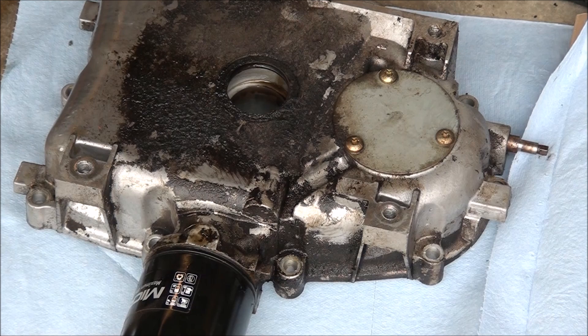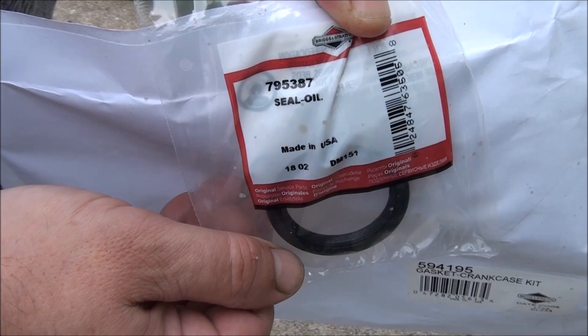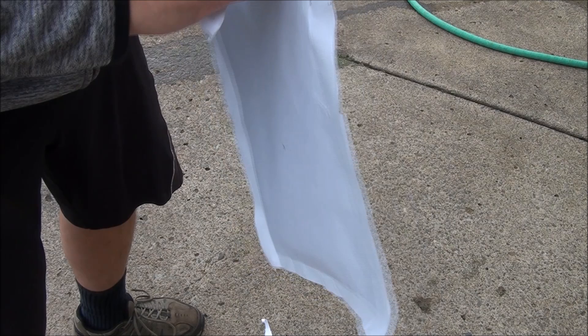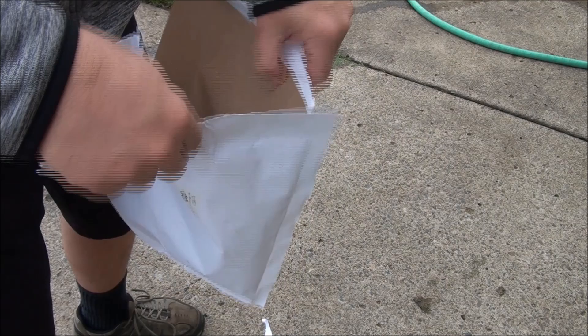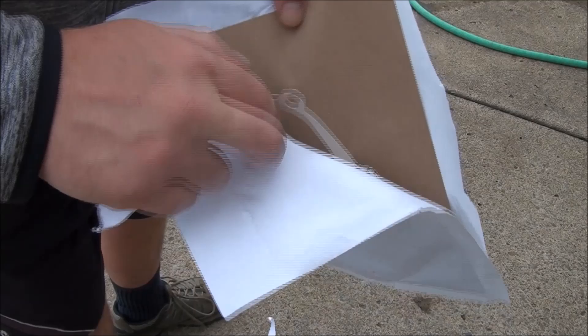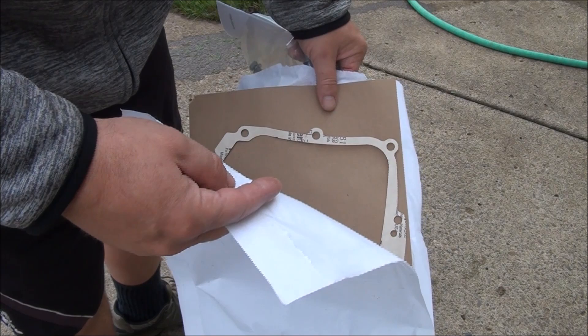Here you can see the part number on the seal, and this is the part number on the gasket kit. I noticed that when I was buying this gasket kit there was an option to purchase the kit that comes with the bolts. Since it was from Briggs & Stratton and they were offering that kit, I figured it was probably a good idea — maybe a hint. As you can see, the new bolts have Loctite on them. It looks like a newer style gasket too, which is a bit thicker. Briggs & Stratton is always good about updating parts that need updating.